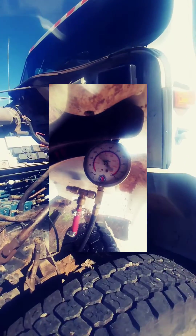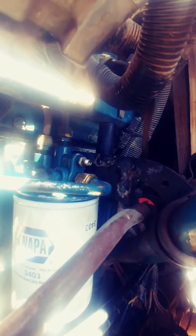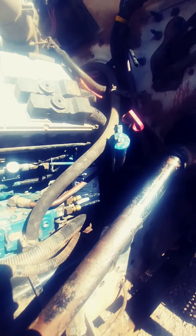You can see I had my fuel pressure tester hooked up. If we go in here, right above the fuel filter, you've got these two lines, and your test port is right there for your low pressure fuel supply. It uses the same fitting as a Ford fuel pressure tester. So you saw what we were getting — it looked like air in the system to me.